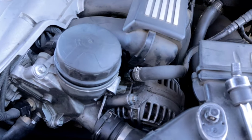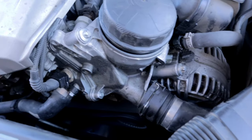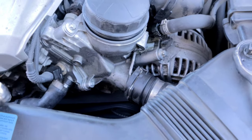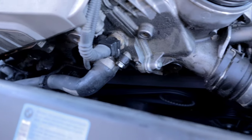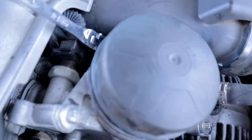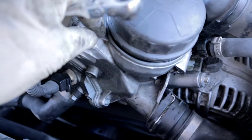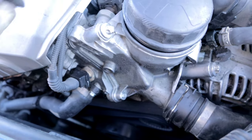As you can see, I didn't remove much coolant — I just wanted the top part of the engine to have no coolant because we're going to be disconnecting the oil filter housing and that has coolant behind it. Now the difficult part of this process is removing this fastener at the bottom and this fastener over here. This top one is pretty accessible, so I already broke that loose — that's an E10.